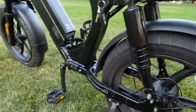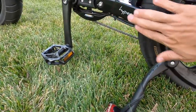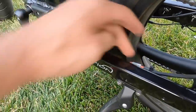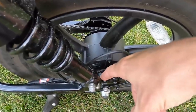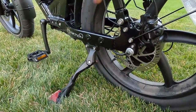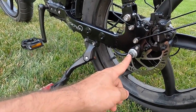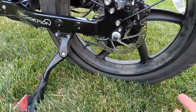Moving to the other side — I just washed it before coming out here and it rode through mud on the way. The motor cable routing is pretty cool: it runs on the inside of the chainstay, threading between the brake rotor to reach the motor. On a lot of e-bikes the motor cable runs along the outside at the axle, but this internal setup from Juiced is much more resilient — if the bike tips over onto that side, an exposed connection could get damaged and leave you with a pedal-only moped.